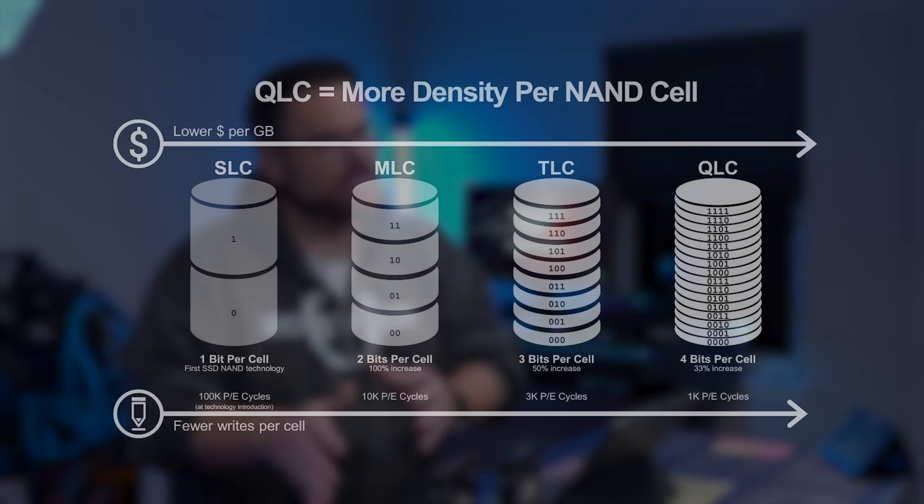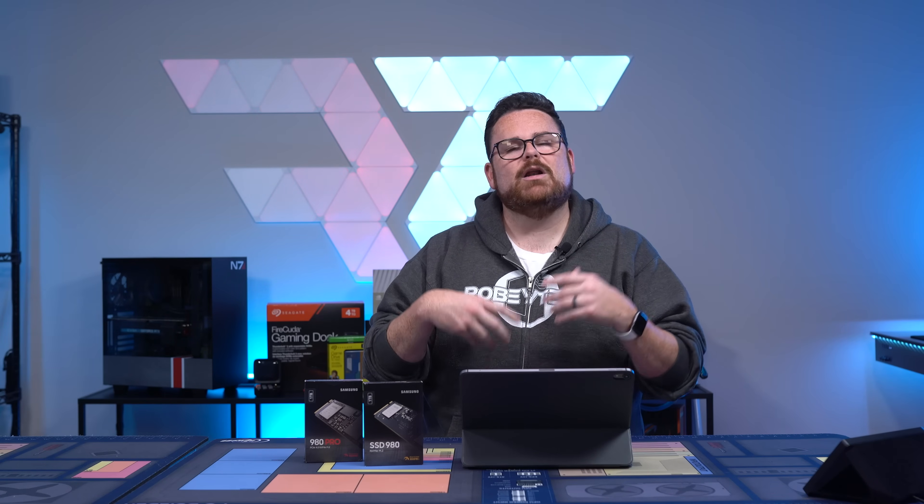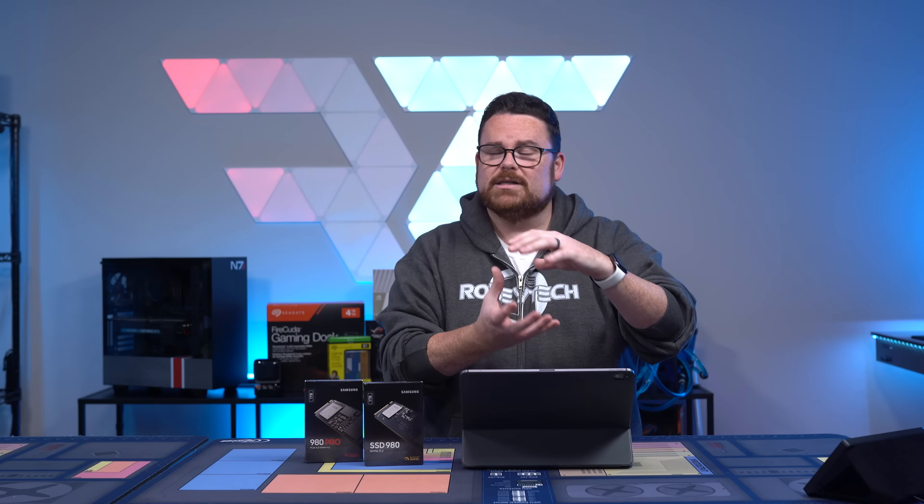This drive is MLC, which is multi-level cell. MLC is known for high endurance and the right balance between the amount of data written in a cell, which means they add things like a five-year warranty. It also delivers performance, meaning data is easier to find and it's going to last longer. The Samsung 980 has a 600 terabyte written overall endurance — compared to 200 terabytes on the 670p. And it actually comes with a five-year warranty, which is huge to guarantee with an NVMe drive.